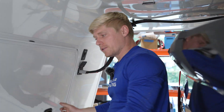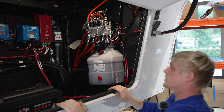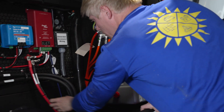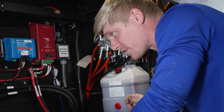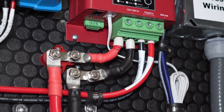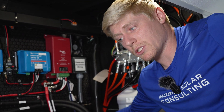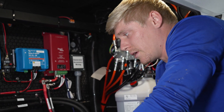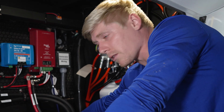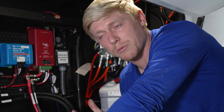Let's open it up and show how we get from here to the DC-DC charger. We've come down the side and the wires connect to a small bus bar, then we jump down to a two gauge, because that's the largest we can fit in the terminals of the Sterling DC-DC charger. We use 1-0 for the length of the run to avoid a large voltage drop — any voltage dropped over the cable is essentially power lost, so the less voltage drop the better, hence the larger cable. Right now we're using a 1-0; we might even step up to a 2-0 in the future.